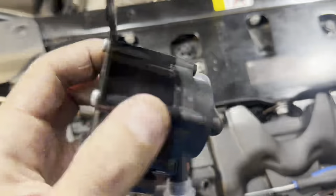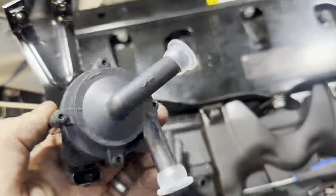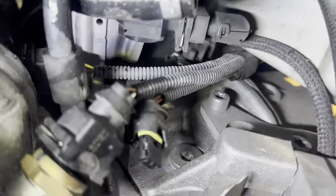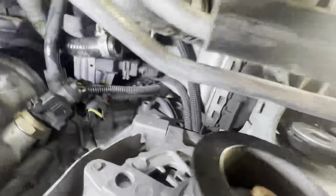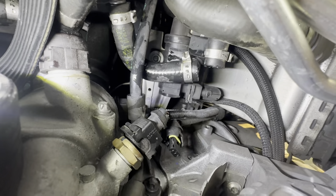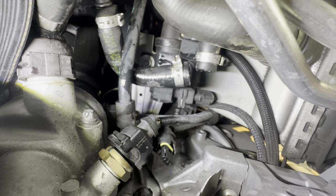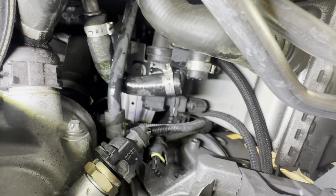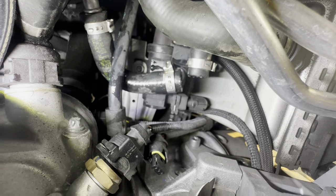Here's the new pump. You're going to want to remove this bracket before you install it to make it easier. The only kind of difficult part will be to get the new clamps on. There are two hoses and the connector. I'm probably going to use worm drive clamps just to make it easier to tighten them — they don't have to be super tight anyway. It'll be easier than trying to get that clamp tool in there, it's so tight.